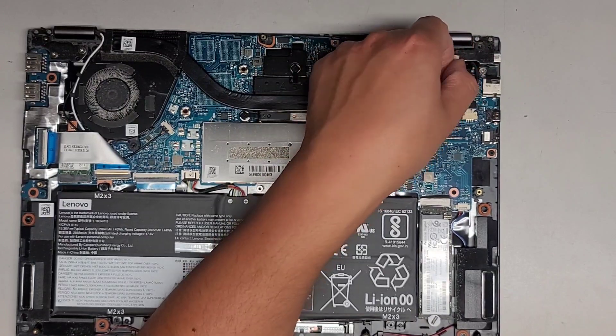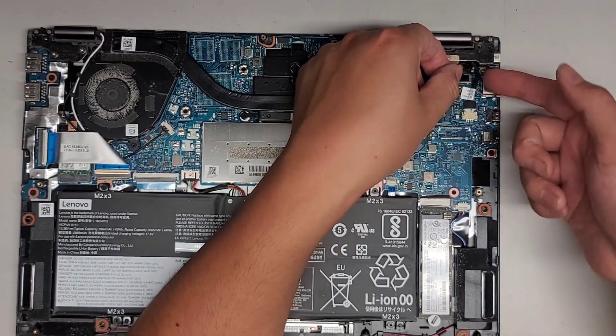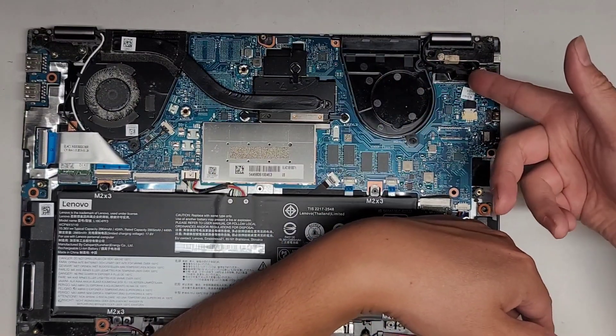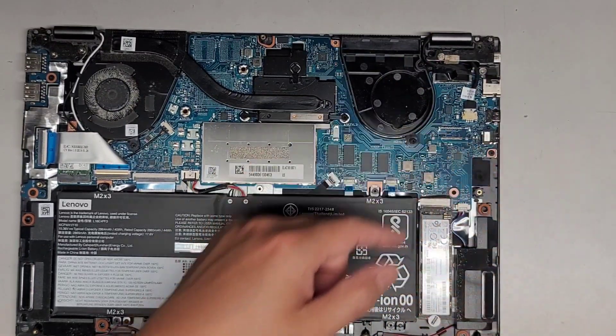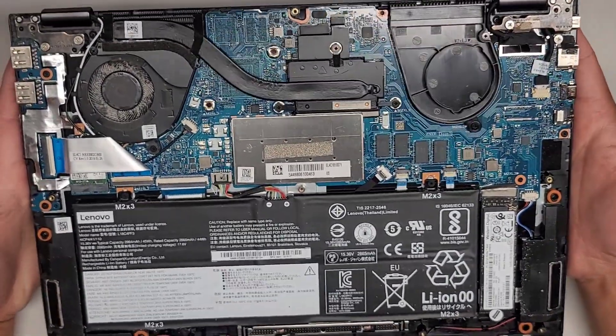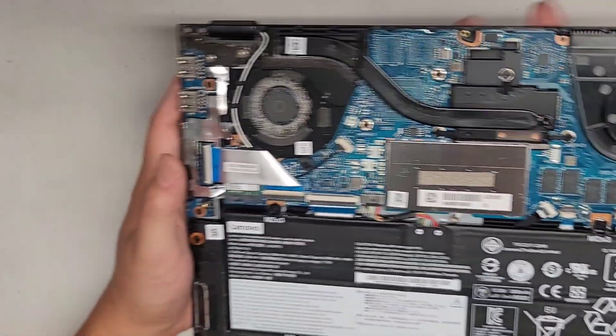To remove this cable, you can grab this tab. Usually it's hard to just pull it straight up — I have to go in with my fingernail underneath the little edge or the side of it and then pop it up while I'm pulling on that. I do have videos showing that as well, so if you can't figure it out, watch a few of my other videos.